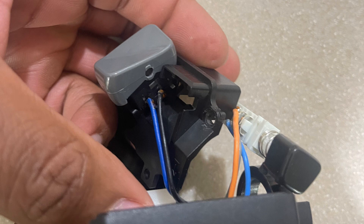Here we have what our original headlight looks like — two wires on there. The black one is power, the blue is high beam. We're going to take the power from here, remove it, and add it to the switch to bring it back on the load side of the switch to the headlight so that it's only activated when we flip that switch. On the furthest right, we have an empty pin — that's where we're going to solder the wire we fished through the harness so that when we press our headlight, it's powered on on demand and not always on.